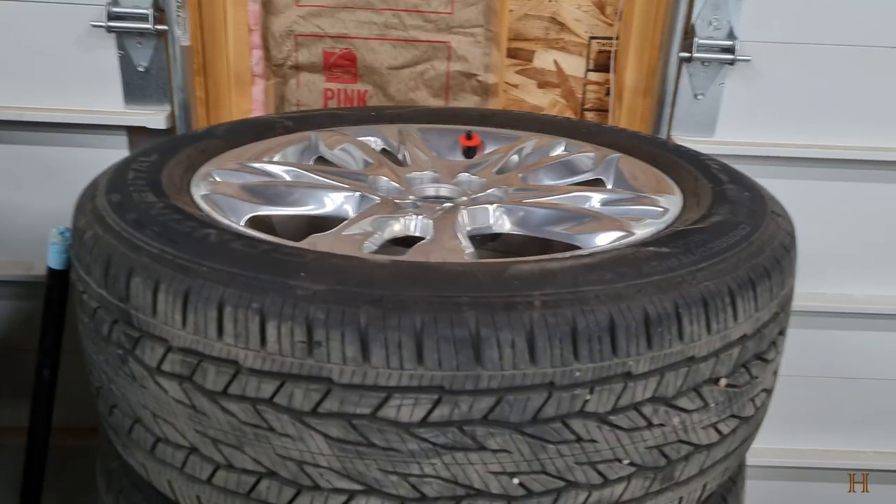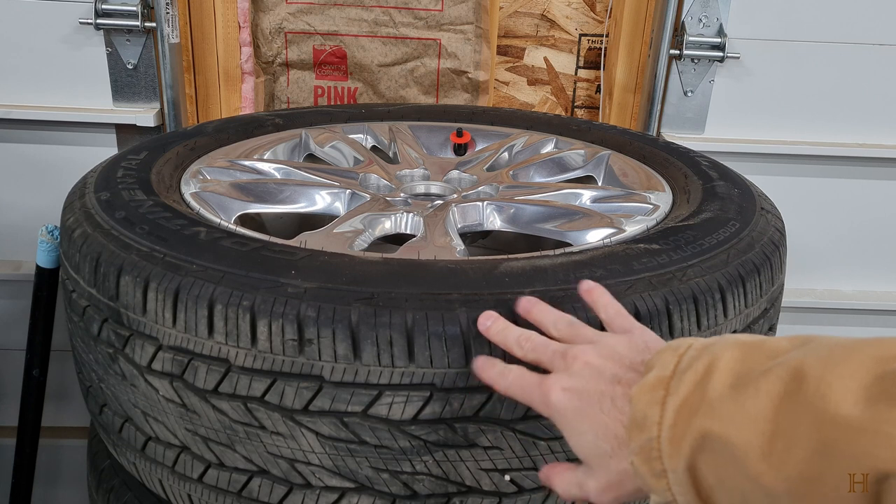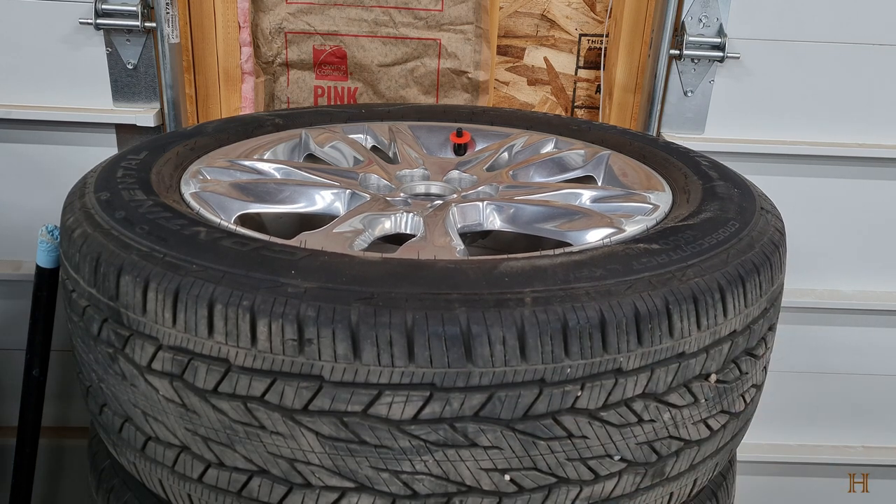So why is that important? The problem is your tire gets hard. The rubber gets hard, the rubber starts cracking and deteriorating, and it actually doesn't hold as well on the road surface anymore. So you might have plenty of tread depth left, but the rubber itself is too hard, reducing its ability to optimally hold onto the road surface.